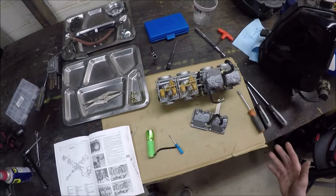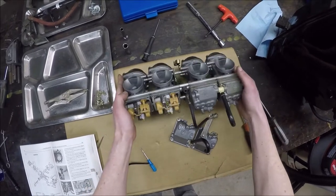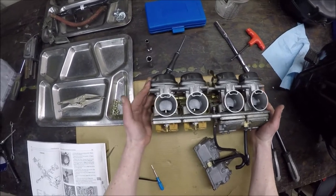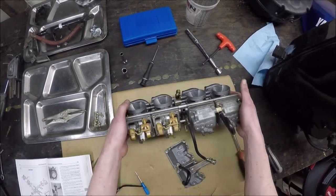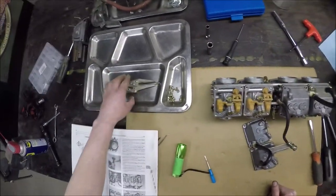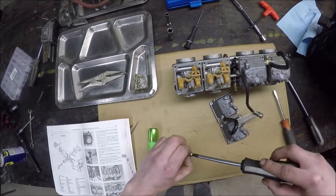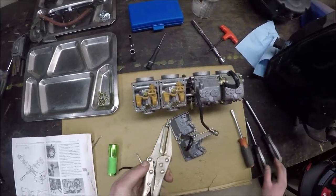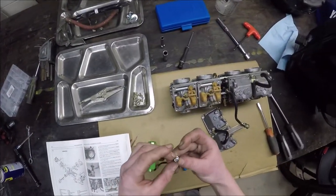I think we ought to just take a look at the carburetor since it's off. This is a really cool carburetor — it's noteworthy that it actually sits on the bike oriented like this, with intake right here passing through into the cylinder on the bottom. I took one side off. As normal, these are JIS screws — they're stamped with that little dot, and a JIS screwdriver will fit right in there. It usually gets them off, but these things are always made of cheese.